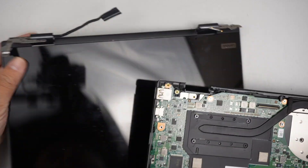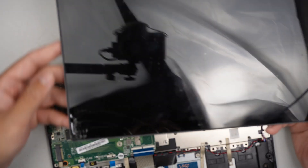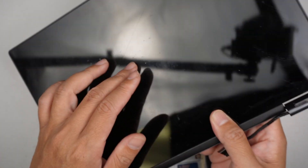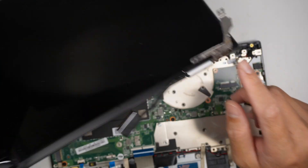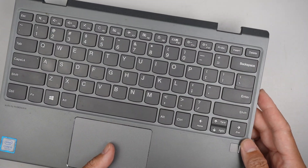The entire screen will just come right off. If you're planning to replace the screen, I recommend replacing the full assembly because this is a touchscreen — if you replace the digitizer with a third-party part, you may run into ghost touch problems. My recommendation is to replace the full assembly with the hinge, even a used one is fine.